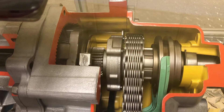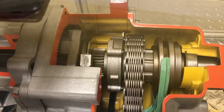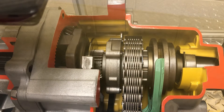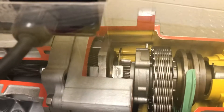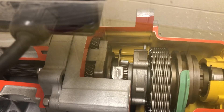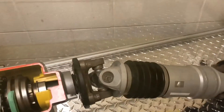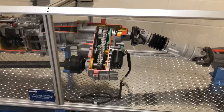So there's four high. The collar moves on the right — that gives you two-wheel drive. And when you pull that collar out about halfway, you've got yourself neutral. That's how those shift collars interact inside that transfer case.